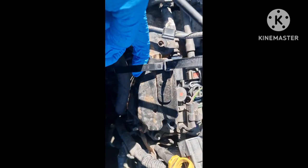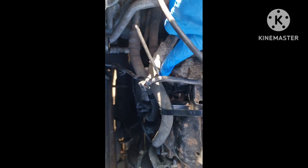when I took it off. I couldn't find it, but I got some nice big cable ties, and these two air conditioning pipes, if you've got air conditioning on there, I've wrapped them around that metal bracket and just pulled them in a bit, because that was pushing the fan system onto the radiator. So I just touched it there, it hasn't damaged it at all, but I've now pulled them out of the way, so you should be able to get the radiator fan housing assembly in.